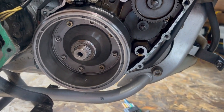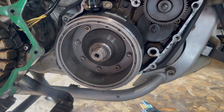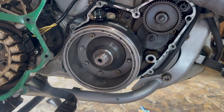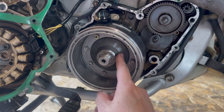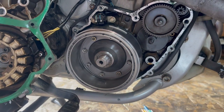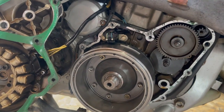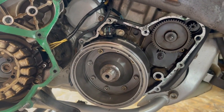Right folks, I'm recording this on my telephone. As I said in the other video, that is the original Aprilia hub now. I put the new one on when I did it last time, and basically the inside of it's gone egg-shaped. The golden rule is you don't do this nut up with the impact gun.